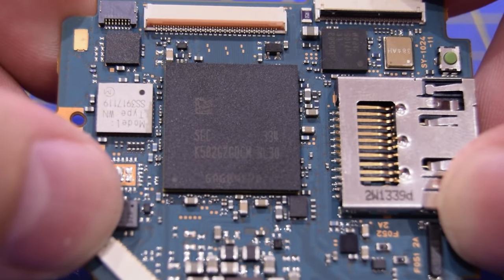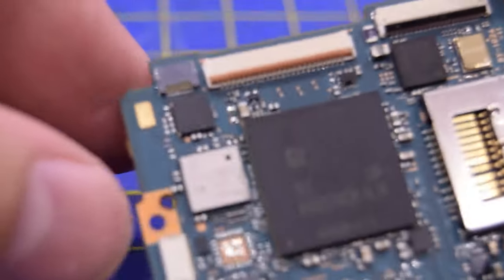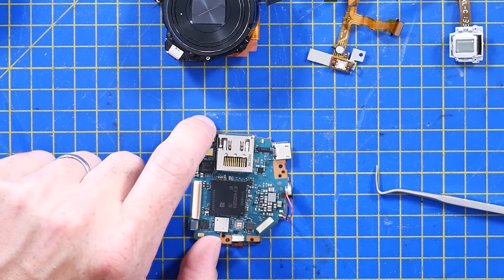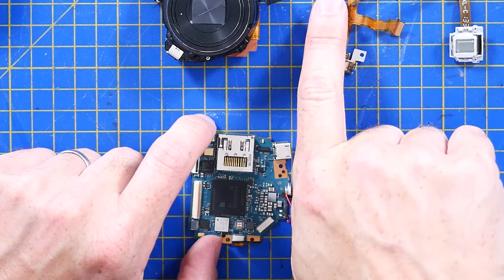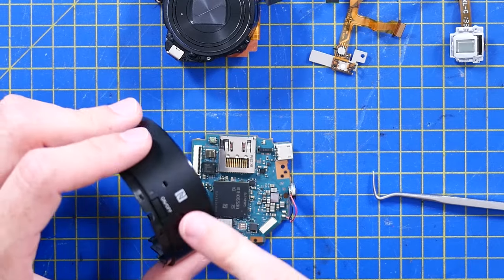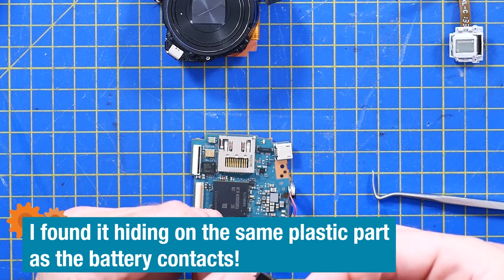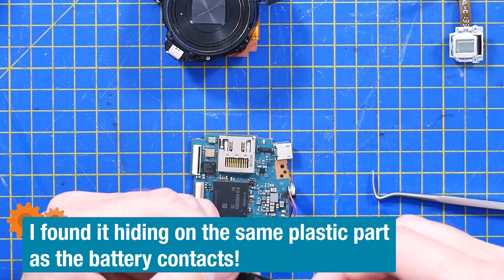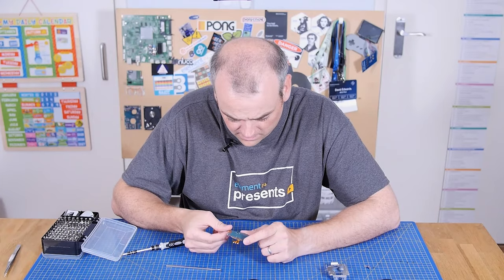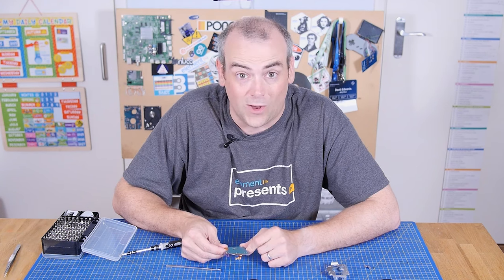Exposed board. We've got a couple of ICs on here — a big one, a couple of little ones. I haven't seen a WiFi antenna. The one at the top — I said NFC sensor — and that is where it tells you on the case to tap for NFC. But I would think it would be fairly sensible to have the WiFi antennas out there as well, just for the benefit of signal strength. Having a PCB-based antenna on here is going to be absolutely worthless.